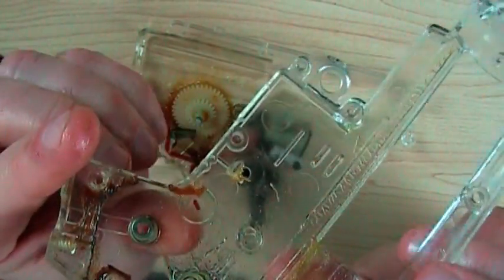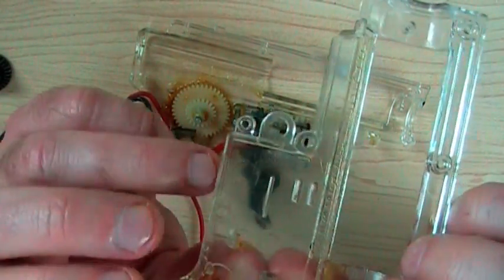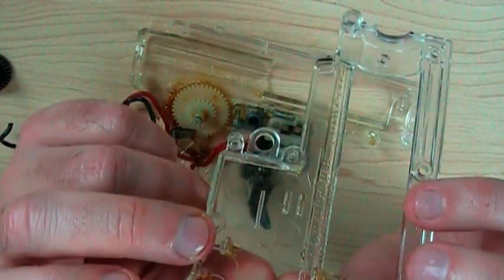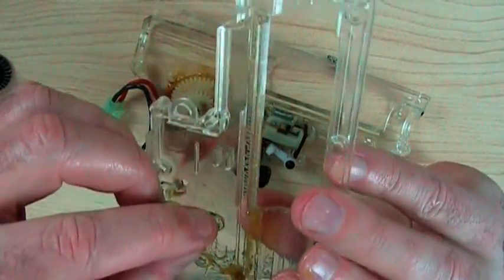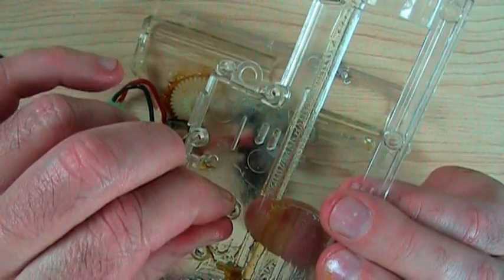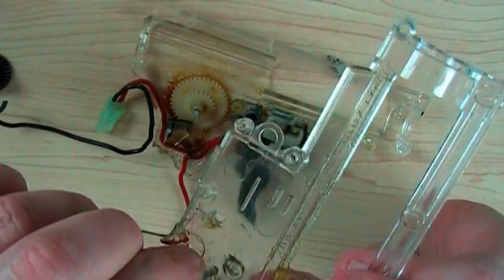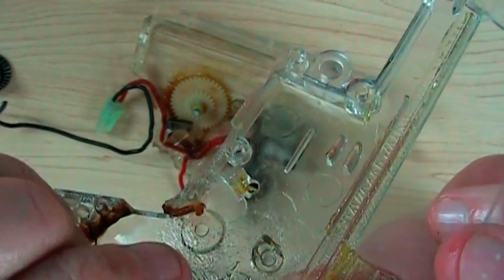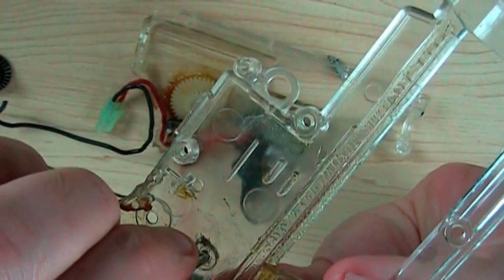Is it melted? It started to heat this up and it actually pushed it, it pulled this whole pin. This pin would ride in here on that gear. This thing came out, it started to heat up and it just drug it through the plastic. You can see a whole, like I said, I don't know how good the camera is going to pick up. But you can see right there, that's what actually happened to the gun.